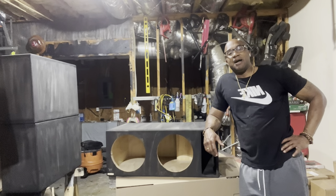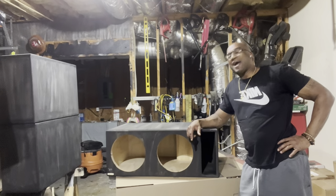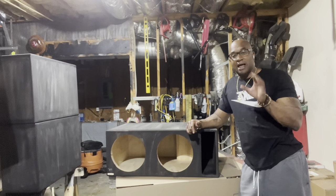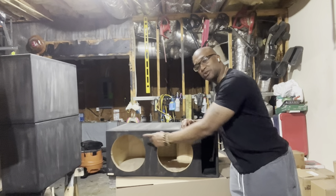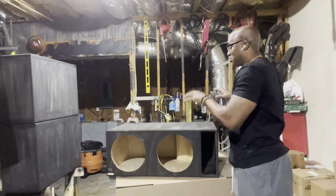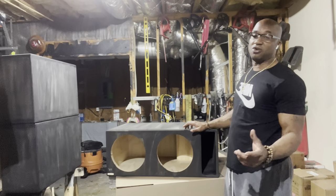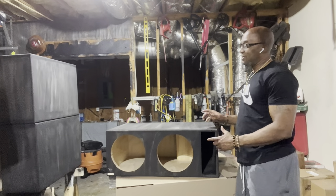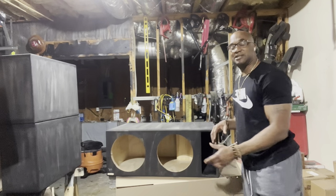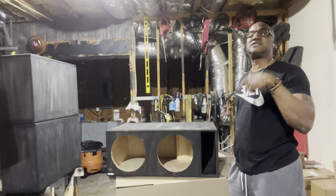Why am I staying here with a basic design box? Two subs and ports. Very simple, because this design was often overlooked — a lot of people like sub, port, sub. So all of you in the SUV, you got sub, port, center. With an SUV you're only going to have one option with that anyway, with that sub port in the center. By putting the port on one end of the box gives you a variety of different listening positions to find out what best suits you.